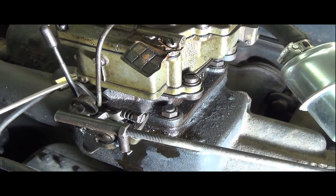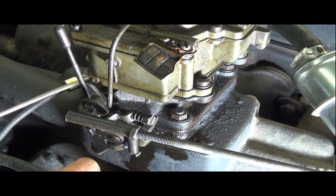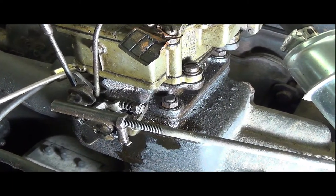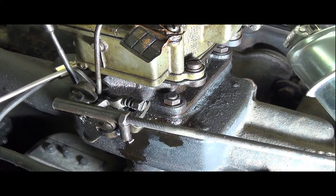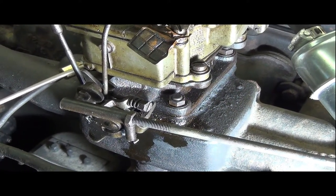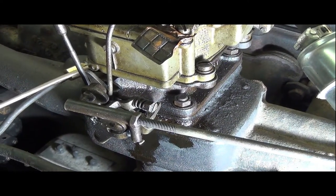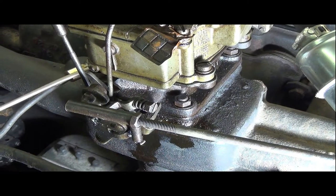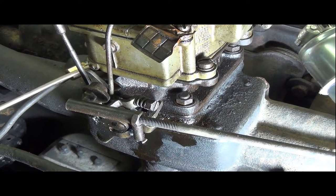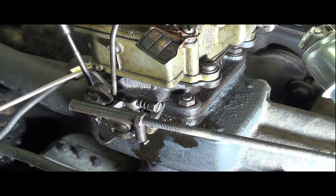So the manual is very specific on where you should put your idle adjustment needles. It also has very specific settings on where you should start with your throttle set screw. So I'm going to go ahead and start up the car and get it up to temperature and make a few marks so that I know what stock is, meaning what we have right now. It will eventually stay running idle and get hot, and then we can maybe play around with a few RPM settings. And I'll mark those idle jets in the front so I know where we started from.